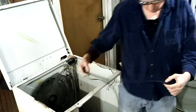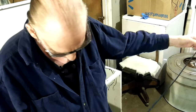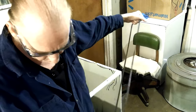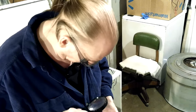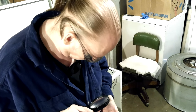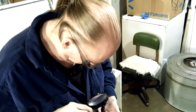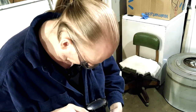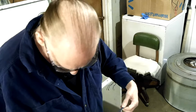I'm going to put the belt on the drum and put the drum back in. The belt has ribs on one side, so I want to turn it so the ribs are on the inside — they ride on the ribs on the motor pulley. Let me check the brand: it's a WCI part number 134503600, made in the USA. All this stuff is made in the USA.